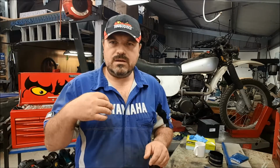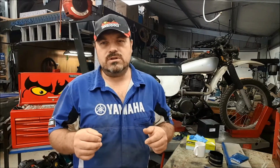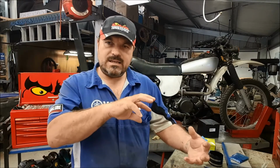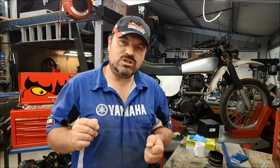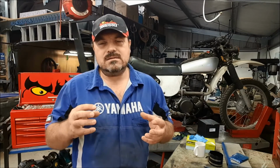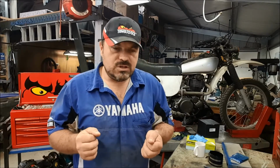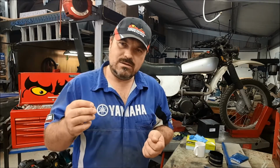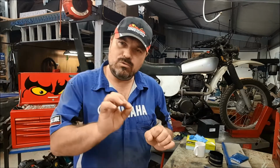This is putting exhaust fume gases into the cooling system and creating gas pockets within the coolant. And whenever one of those gas pockets trundles around the cooling system and goes past the engine temperature sensor, a gas doesn't conduct the heat, doesn't transfer the heat anywhere near as well as a liquid. So the temperature sensor usually will read cooler, for that moment in time.